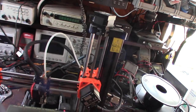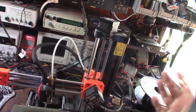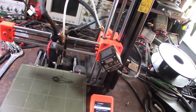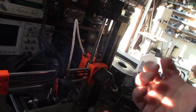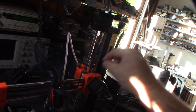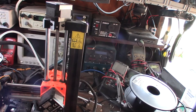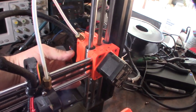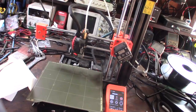All right, purging done, closing the cover. I figured out the issue. I loosened the tension a bit — over time you get a feel for what the tension should be. You don't want to over-tension it. It needs to be pulled back just enough, not too much. It's hard to describe exactly how much.